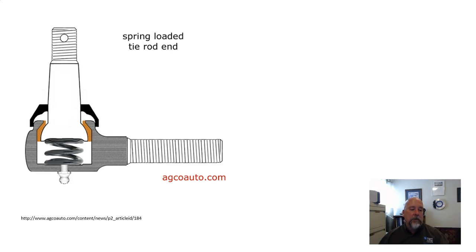So if you grab this with your water pump pliers, in effect you're just compressing that spring inside that's designed to be there. So you're simulating a fault that doesn't exist. So I will just leave that water pump plier check out of the equation.